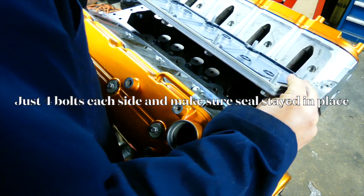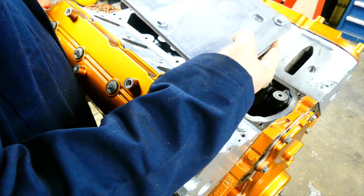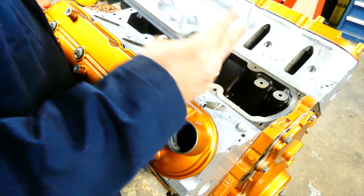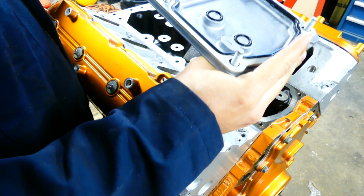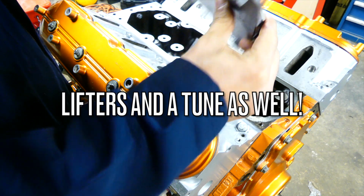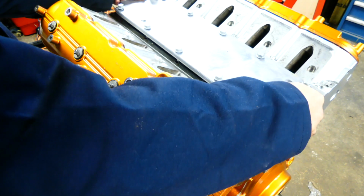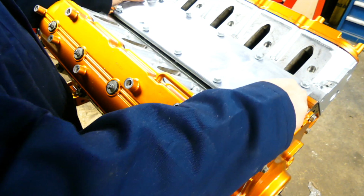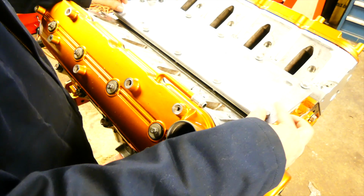So this is the lifter valley plate. It's a GM Performance part number. I'll list it in the description. This is for the DOD delete. So you gotta do the cam, and you'll need this plate as well. So you just lay the plate on. Line up the hose, and this gets torqued down to 18 foot-pounds. My torque wrench don't go that low, so I'm just gonna torque it down to 20 foot-pounds. It should be just fine.